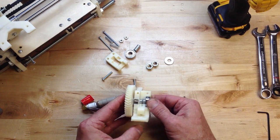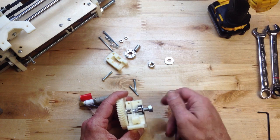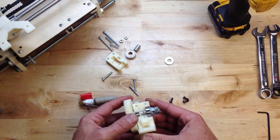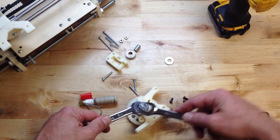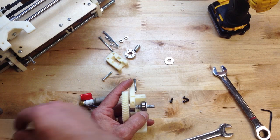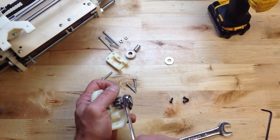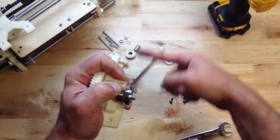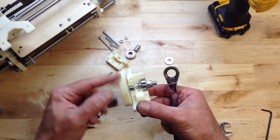Now here's where I'll check — that's good, that worked well. With one washer on the inside, one on the outside, you want this to move pretty good. You could leave it just like that. To tighten these guys, you hold the bottom and just give it a little snug. Now, another alternative to the jam nut is two nuts — jam them against each other to hold tight. This is optional. This is kind of a nice addition: this is nylock, which has a little piece of plastic on the end there. It makes it impossible to turn by hand and also impossible to get loose. I tighten it down all the way — too tight — I'll back it off a little bit. Works good, so either way.